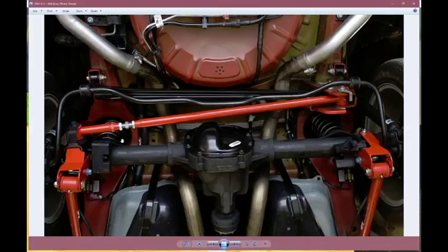If you only look at these links, there's nothing stopping the axle from going side to side — just forwards and back — because the springs won't stop that and neither will the shocks. So a panhard bar goes from the chassis or body — this looks like a unibody — across and down to the axle.